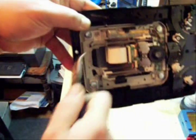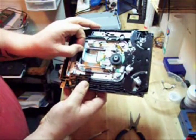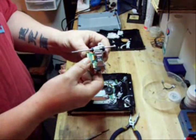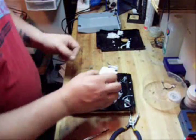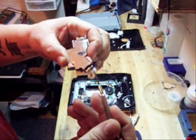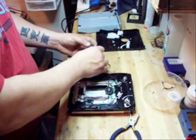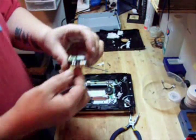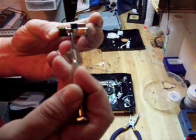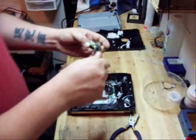I just bend that tab down like so. Now I'm going to unclip the ribbon cable and slide the rod back — and it comes right out. One screw and you bend that little rod clip, and it comes right out. Same as the 400 lasers — there are two clips you have to change: a plastic clip that rides on the worm gear and a black metal screw. I'm going to take that out. On the opposite side there's a spring clip. I'm going to take that black screw out and pull that little metal spring clip off.